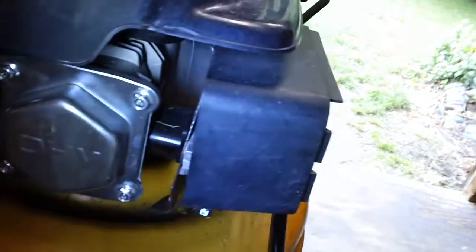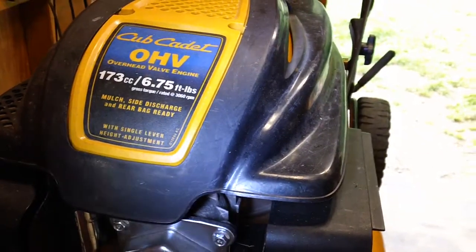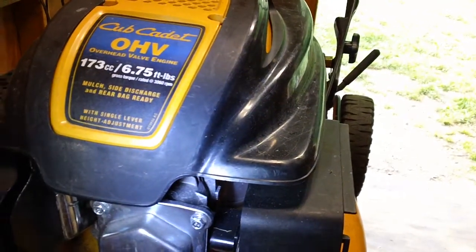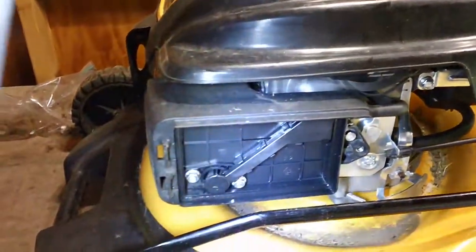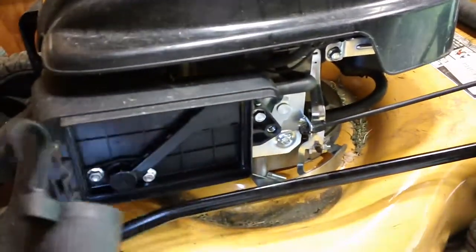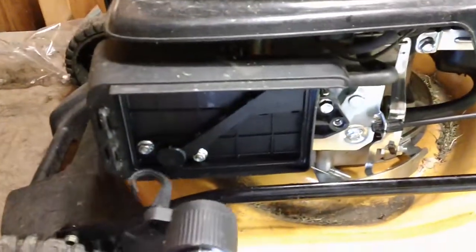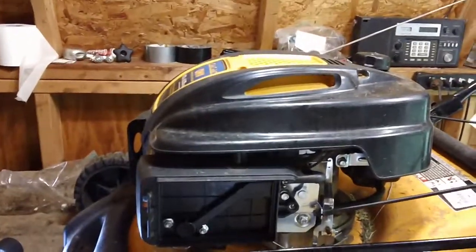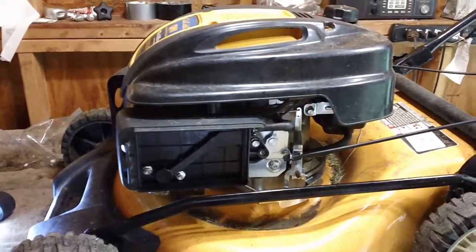That's a review of your typical intake and the problems you can have on these various machines — these Cub Cadet overhead valve engines. As I mentioned before, most people don't understand about the Chinese quality on these. Also, these air boxes do warp from time to time. I've actually seen one that was almost bent inwards from the heat coming off the engine, or from someone dropping something on it. Always keep an eye on your air box gasket — sometimes these things can leak around the edges. Make sure they're always sealing right, because if you let bad air past, you might damage your engine internals.